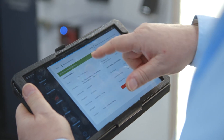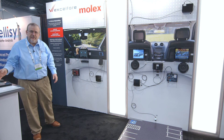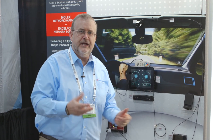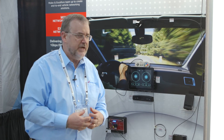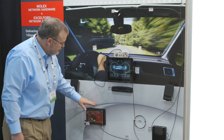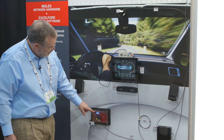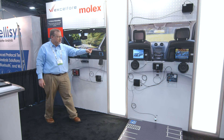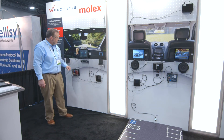That campaign has now deployed, and we will watch its progress. The first step is a security negotiation between the server — the eSync server on the cloud — and the vehicle. Once the security profiling has been completed, the server will begin downloading the software, and the eSync system in the vehicle will begin updating the various elements even as the software is continuing to download. We now see on our screen the first indication of progress — that software is now coming down. While that is installing, we're bringing down the new software for this unit. You can see this unit is now being reprogrammed. This one has now been completed. The head unit and the media module have been completed, and the new software for the tire pressure system is coming down.